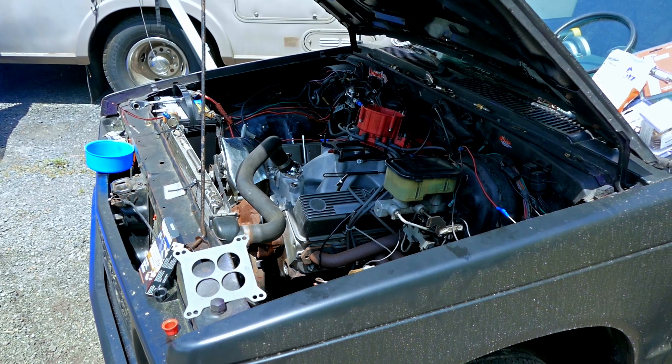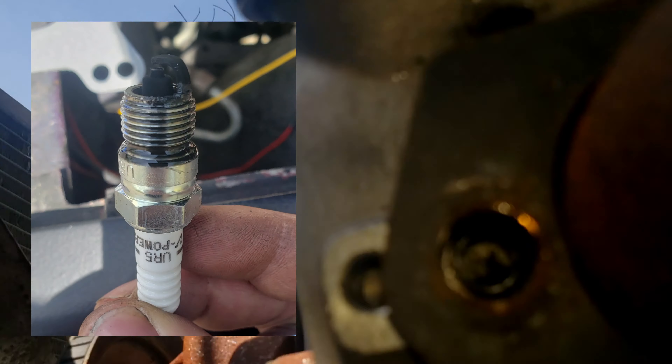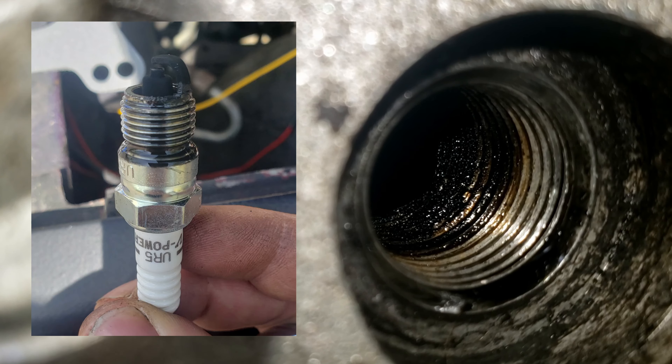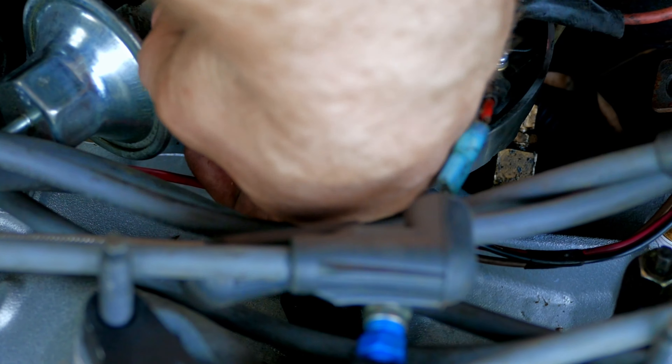Then I say, listen, I like to start from the easiest things first. Let's look at the plugs. The plugs look horrible and they look the wrong size. I just take the phone and peek in here, and of course the plugs aren't going hardly into the cylinder. Please change the plugs. Look at the next thing, and of course it's got the distributor that I despise, especially on S-10. It's super hard to get to the bolt to lock that guy down.